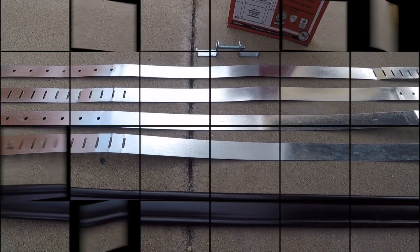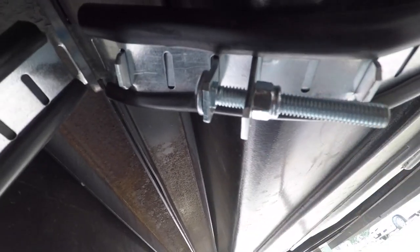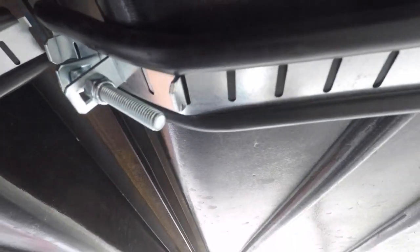The first of my two brackets is in place. You can see the quarter-inch bolt going into the rail and the strap I used. Remember how loose this tank was when you'd push it up and down? Now it is tight — it does not move at all. I strapped it up tight through my bracket; the two hook ends pull together. When I started tightening, the slot was all the way out, and I cinched it up that much — it pulled the tank up that far and now it's cushioned, supported, and securely fastened.